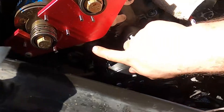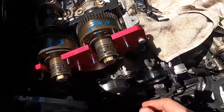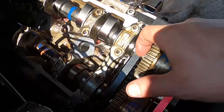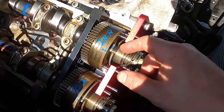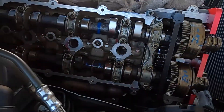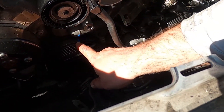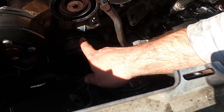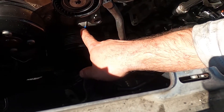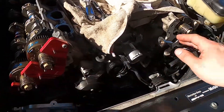We've got everything all set up - right exhaust, intake, right exhaust. It doesn't necessarily matter where you have your orientation; you just want them as close to pointing upward as you can, so that way you can put in that little service screw. You can see where my markings are - they're relatively close to that original up mark that we had when you are at 40 degrees, which is what these marks are right here. I'll put a blue mark as an easy visual reference, and that's going to line up with that there.